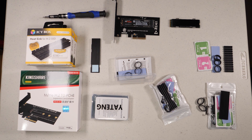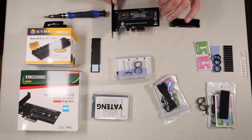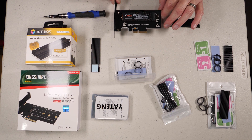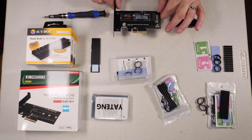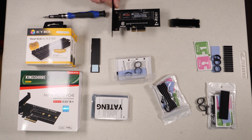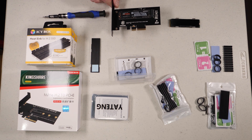I'm not going to test them all because they all perform about the same with a couple of minor exceptions, but I wanted to go over some of the different devices available. We're going to do a quick test using this plug-in card with a Samsung 970 EVO Plus — we'll run it without a heatsink first, measure the temperature while hitting a benchmark, then apply one of these heatsinks and retest to see if there's any difference in performance and temperature.